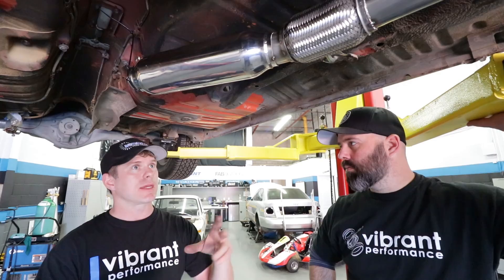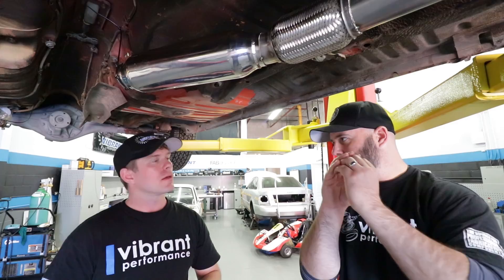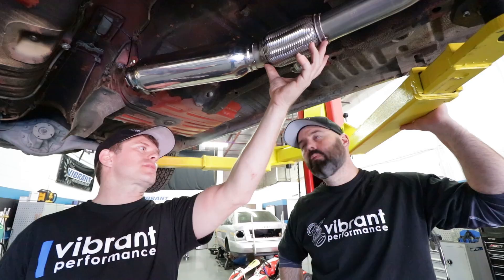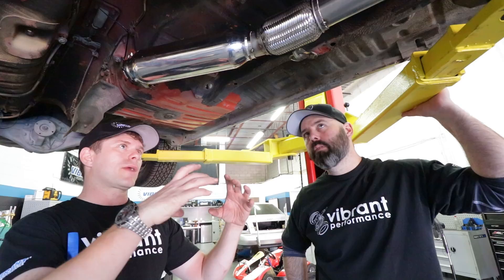And it won't choke out like a braided liner when there's excess heat in the exhaust system. By 'choke out' — what we've seen happen on performance applications with a braided inner liner is that the braid will expand and try to lengthen while it's in its preset length. The only place it's got to go is inward. So when it lengthens, the braid actually shrinks down and chokes the exhaust. Crazy — I never heard of that.